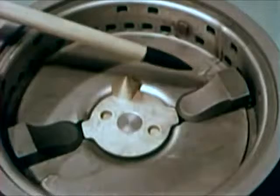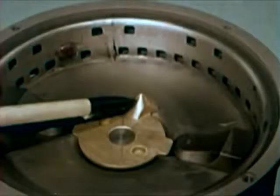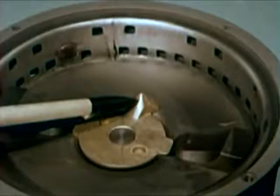These are the two impellers that hold food wastes against the shredding ring until waste is ground finely enough to be washed down the drain. And watch this. If a bone or other type of really coarse particle should try to jam the unit, the jam-resistant impellers back away and rotate to clear the jam.